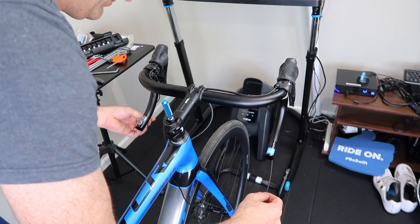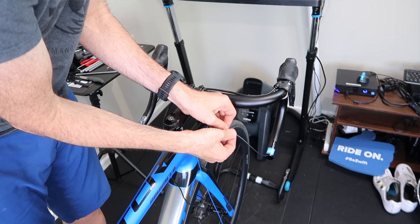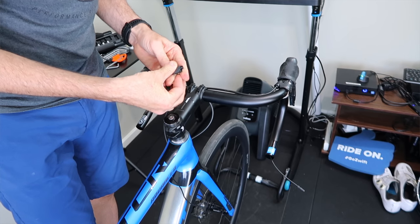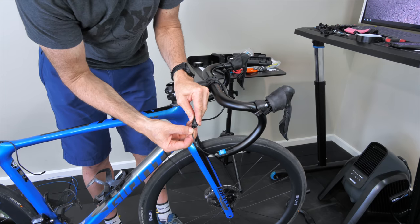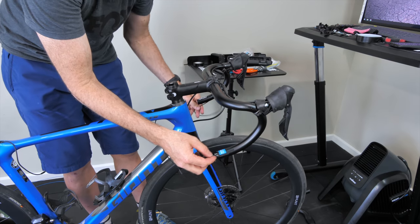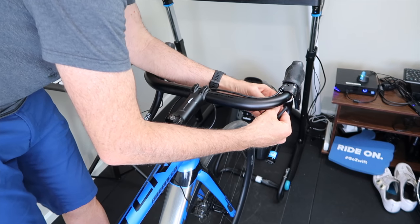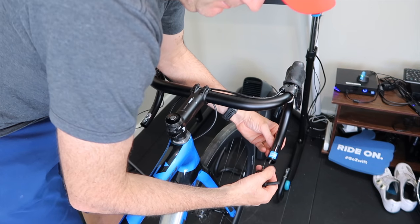People have always told me this kit is fantastic — I never knew why until I'd done that. Off with that, and on with the wireless module which I'm relocating. A little bit of bar tape around the wireless module so it won't rattle around in the bars, connecting it in line and shoving it up the handlebars where it's going to live from now on. Next up connecting the right hand lever — same cable as before, into the lever, around the front and into the Di2 port which is already pre-drilled on these bars.